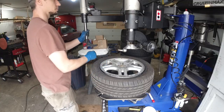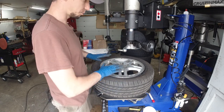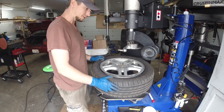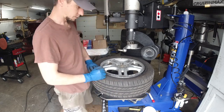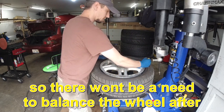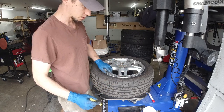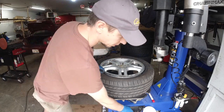So this machine has three arms — two extra helping hands. I probably don't need to use both extra arms, at least not the one like this, because it's a 205/55/16. The 55 meaning the profile — that's pretty high, which means the higher the profile, the easier it is. But I'll use it anyway just to show you. First I'm gonna mark the tire where the stem is. I've got no weights on the outside of the rim, so I don't need to take any off. If there was one, this part — which is actually plastic — would protect the rim, but you want to keep it away.